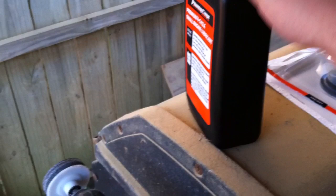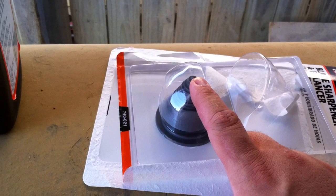So I'm doing some overdue maintenance on it. We're going to sharpen our blade over here, which I've got in the C-clamp, with the cutting edge on each side. I've got my cordless drill with a blade sharpener attachment on the end — that's going to make my job a lot easier. We've also got a quart of 10W-30 oil for four-stroke small engines, and a balancer. I want to make sure the blade is balanced or you're going to get major vibrations and shakes — your lawnmower's not going to be too happy.